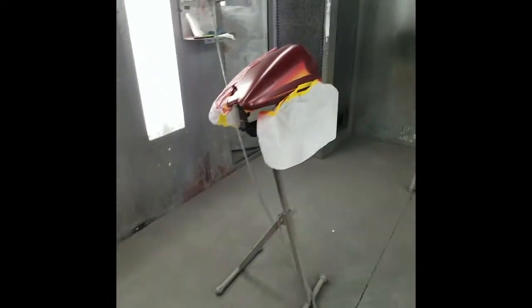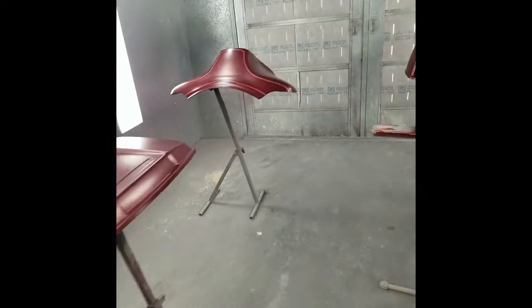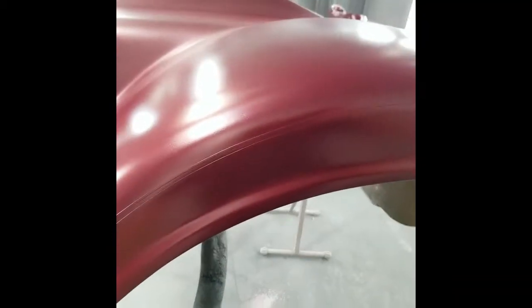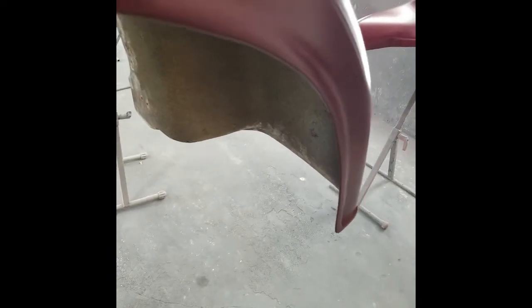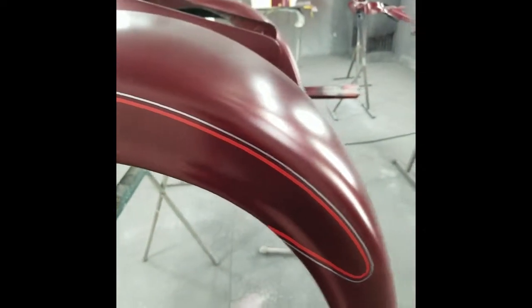This whole process took me probably about two hours including dry time, so to do three colors — not too bad. I'll be clear coating in probably about 20 minutes. I have a little bit of cleanup as you can see on the body — it pulled where it was very tight. This side was completely cracked so I had to rebuild it. I'll have some touch-up in the corner; really won't know until I get the tape off. Actually it came out very nice — the other side did pull so I had to brush or spray that back in. I'll clear coat these and be right back.